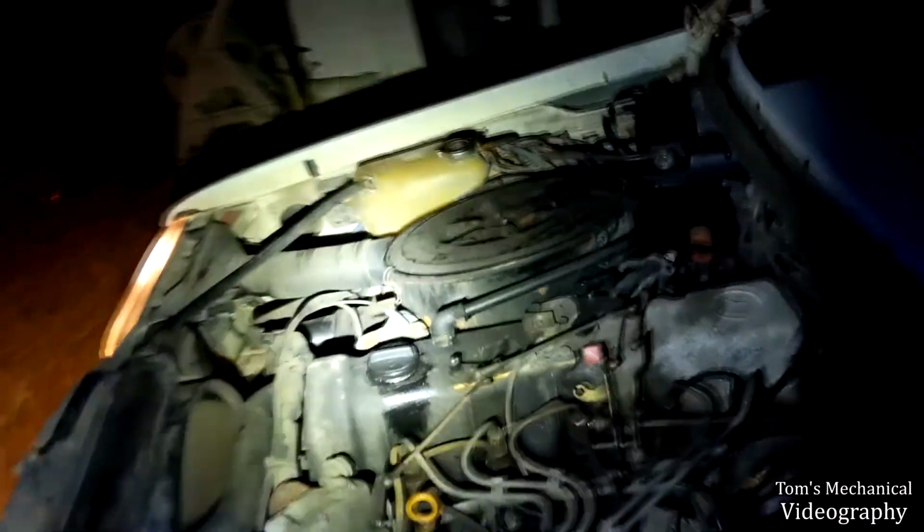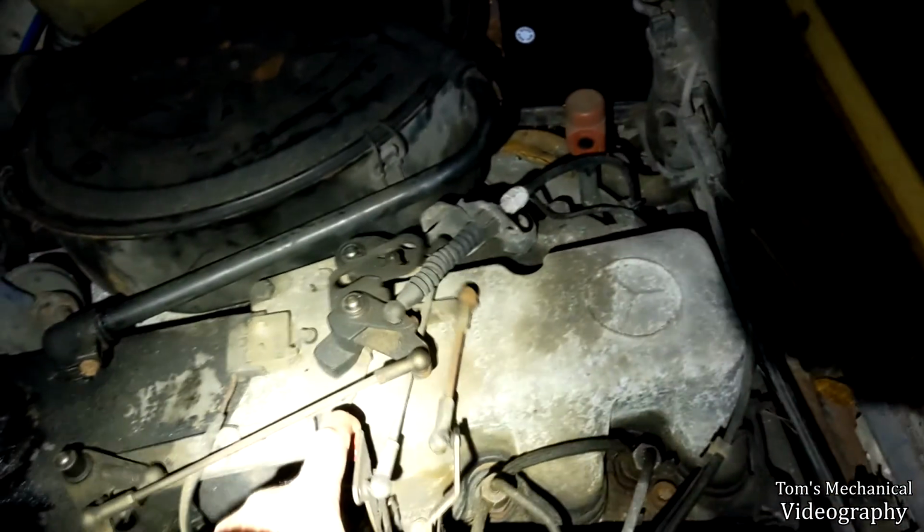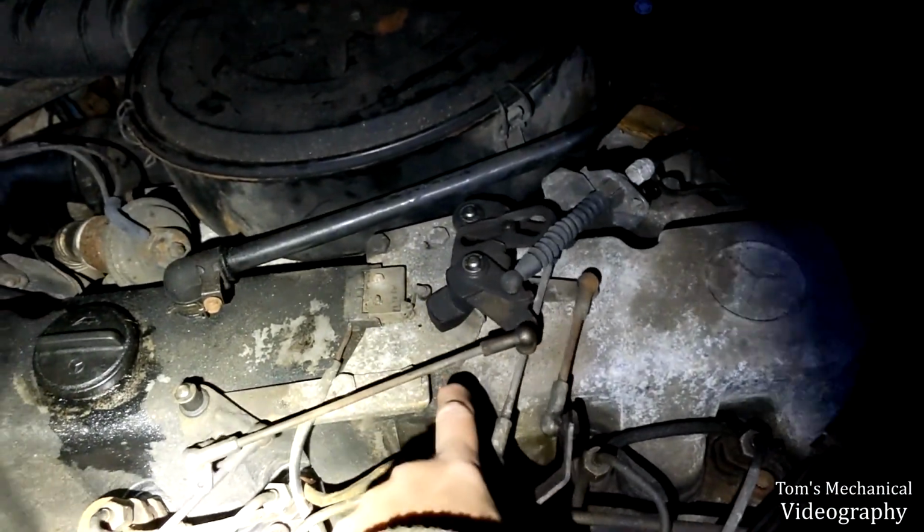I'm gonna let her sit here a little bit and see if she gets any hotter or any colder. She might have stabilized. I don't see any water boiling off. Oh, we still got water in there, so we didn't lose anything. Water pump's not leaking. Short hose isn't really leaking. Not too much going on down there. We got a lot of blow-by now. Tone of the engine has changed. She's squeaking up at the front. I don't like that.